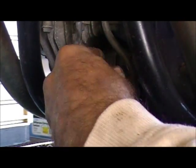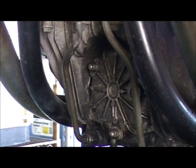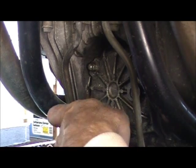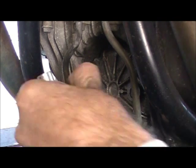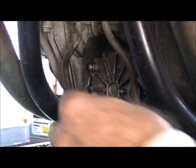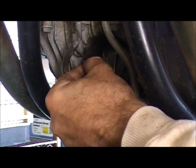There's three bolts on this cover. I don't care if you've got the oil cooler or not because those oil cooler lines don't come off with the cover — that's really all just in the pan. Go ahead and pop your three little acorn nuts off. Make sure you pull your washers into your hand before you pull that plate, because if you've got oil in here, you don't want to drop them in there and have to fish around for a washer. Trust me on that.